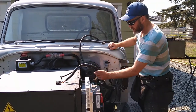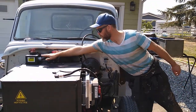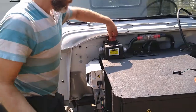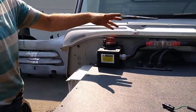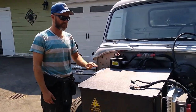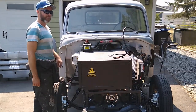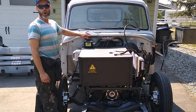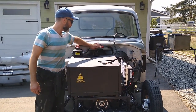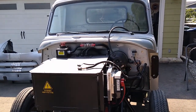Behind you you've got the box for the rear battery? The rear box yeah. The only other thing I did up front was I fabricated the master switch box here. So when you're working on things you kill it — if you switch it on that connects the rear battery box, the front battery box, everything to the contactor box. High voltage — so we want to be able to switch that off if we're ever going to be servicing any of this equipment. And then this is my main fuse, the high voltage fuse before it goes into the system because everything needs to be fused.